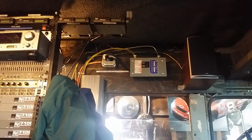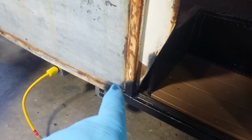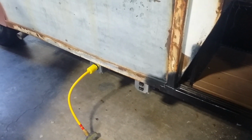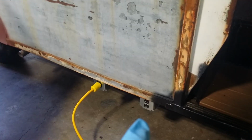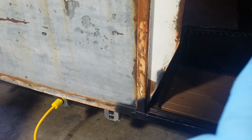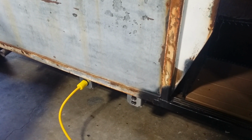Next is this outlet that I brought a circuit over from my panel, so it's nearly a dedicated circuit. I'm actually running that battery charger and the refrigerator on it, but it comes out of the panel under the vehicle and lands at this outlet, so that anytime there is power to the step van, that outlet is also hot. So think about this. I'm running my 3500 watt, my 4000 watt onboard generator, and maybe I've got my EU 3000 plugged in at shore power on the other side. Now I've got 7,000 watts of power available.